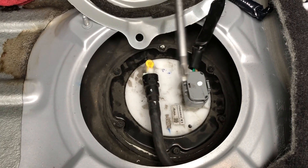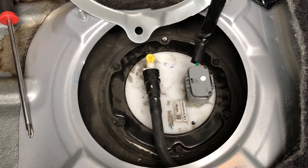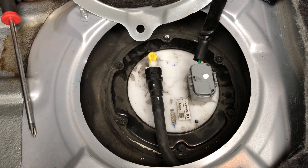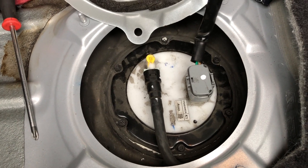Right now I'm gonna cycle the ignition and see if I hear the pump priming. If I do, it's getting power and it's pumping - then all it has to do is run the engine.